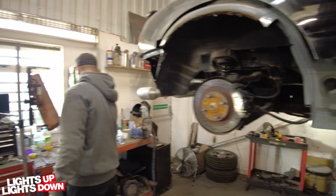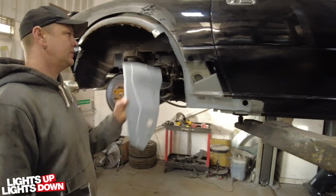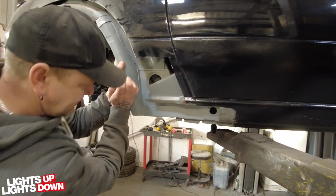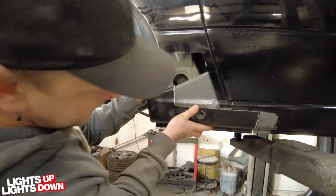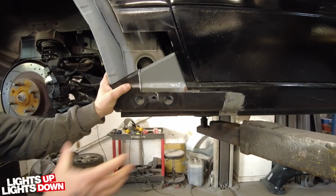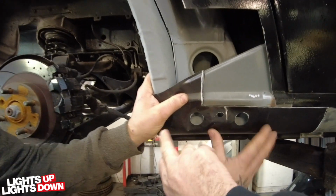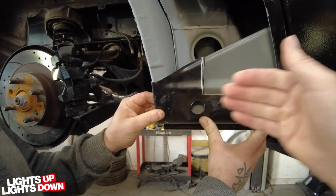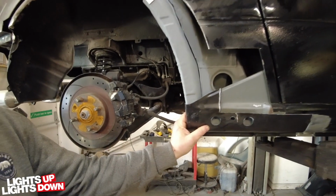So, and we've also got our inner sill cut to shape. So, that back in now, and that goes in there like so, and that's your structural part of your car back together. And a crucial point is where this finishes here, isn't it, for the panel that goes round, because if you get that in the wrong place, especially if you get it too far that way, your outer panel is just going to be an absolute nightmare to fit.